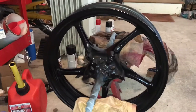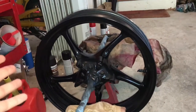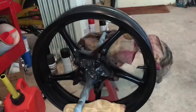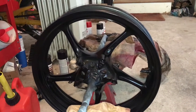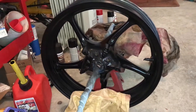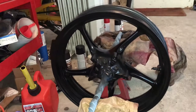With black, that's pretty hard to have happen anyway, but it's always better to be safe than sorry when you go to the trouble of properly doing a paint job. What I'm going to do — and you don't have to do this, this is a finished product right here — is take a little buffing compound, like what you'd use on an automobile finish, and buff up that clear coat a little bit to make it look real clear and real shiny. If you ever have problems with a clear coat being fuzzy or opaque instead of clear and crystal looking, it's because you need to buff it — sand with a really high-grit sandpaper or use a buffing compound to get a mirror finish. And that is how you paint a motorcycle rim. Thank you very much for watching.